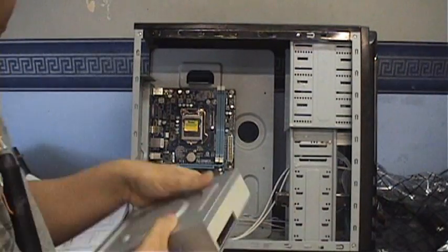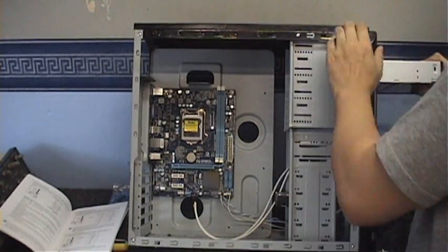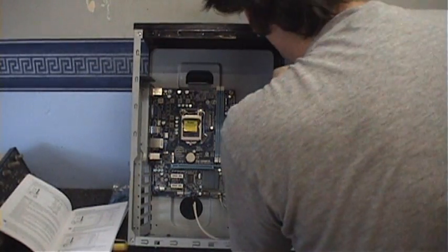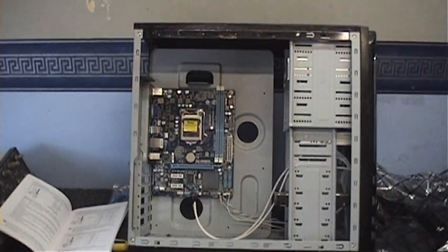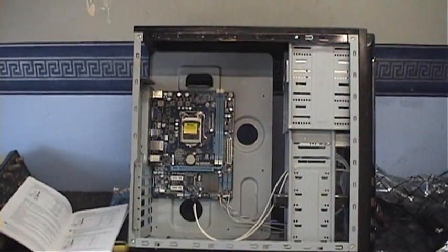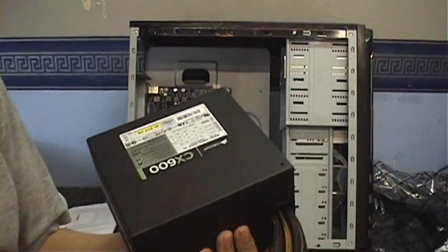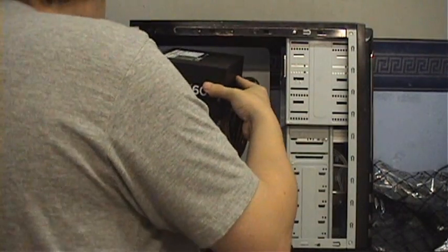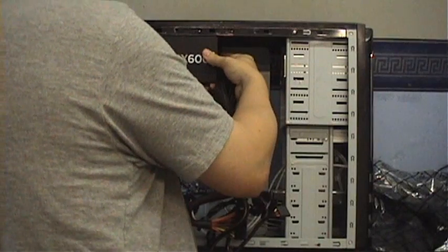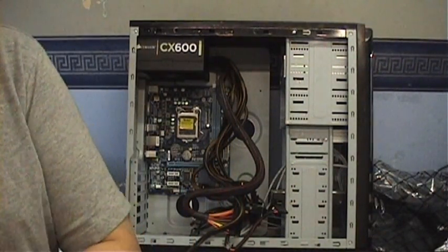Now the optical drive — I'll just go over to the other side and slot it in. I'll put the graphics card in last when I can be certain everything is working. I think the power supply will go in now — it's a great big heavy thing. I can tell you this packaging at gaming is not anti-static because I got a shock off that. Anyway I hope that didn't damage anything — it is heavily shielded so it should have survived. Let me just screw that in so it doesn't fall out and destroy anything.